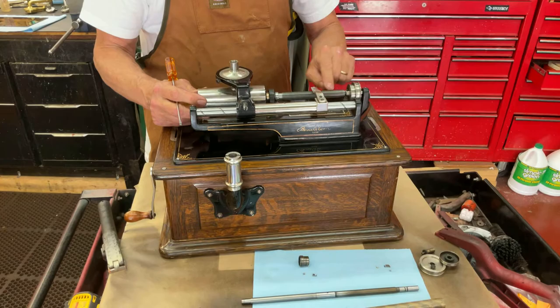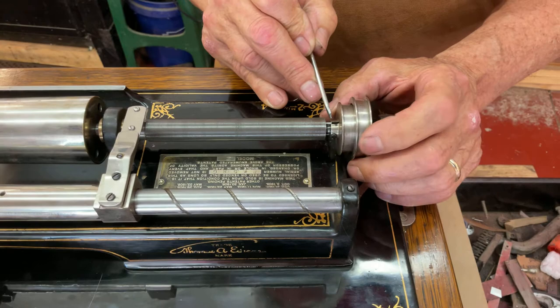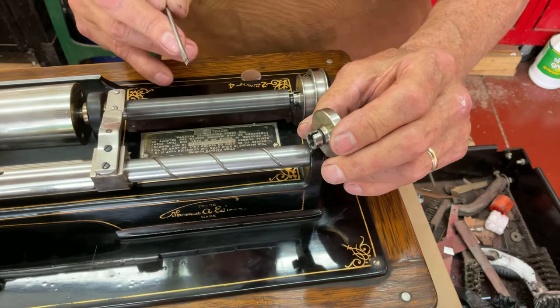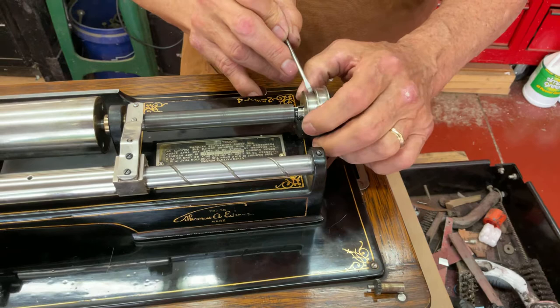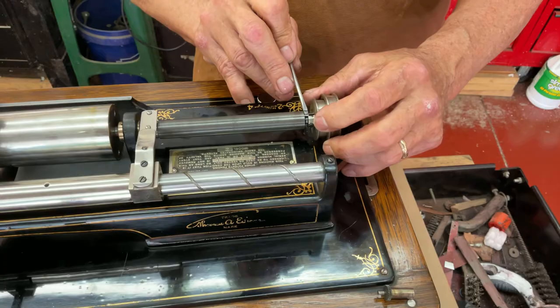The other thing is the lead screw, which is this piece here, has a pin here and a pin here. When you're in two minutes, you want to make sure that the pin is inside the slot of the changer unit. You have this slot right here, and you want to make sure it's not popping out, and how you do that is you adjust the pulley side to the bearing. This is the bearing, and you have to make sure that it runs, because when you go to two minutes, there should be a little gap here with the pin, and when you pull it out, it should be locking in also.